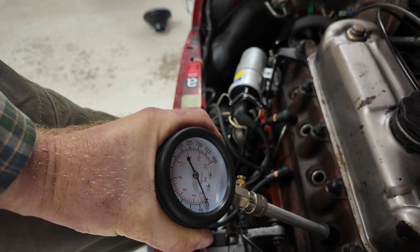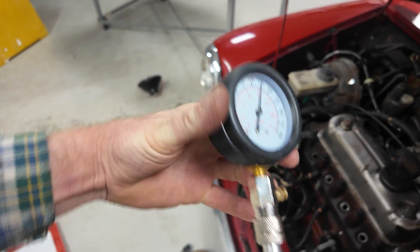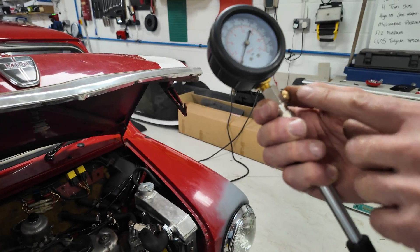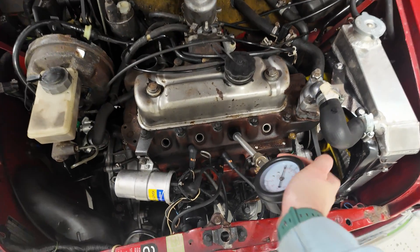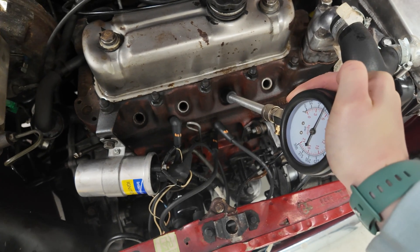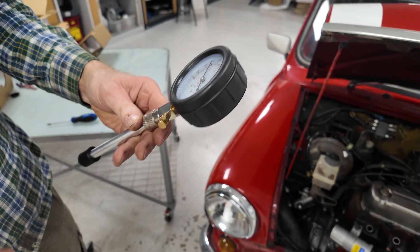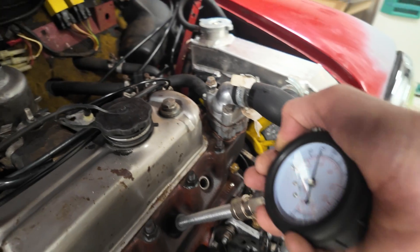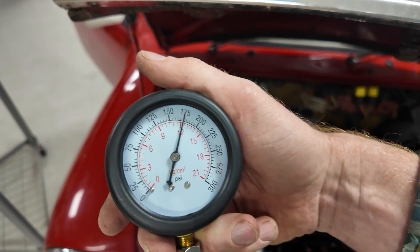Check it's in neutral so you don't run me over. Okay - you can see it's reading about 175 on cylinder one, that's good. Now there's a little reset button - press it and it resets to zero. Cylinder two - hold it in because it's going to try and puff its way out. What have you got? 75. Oh, that's seriously low, that's not good. Let me check you've done that right - hold on, swap again.